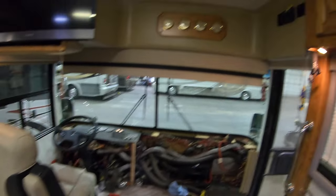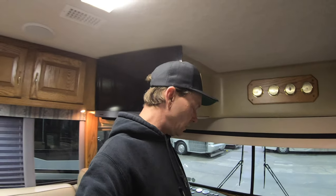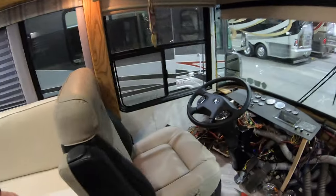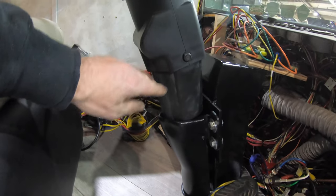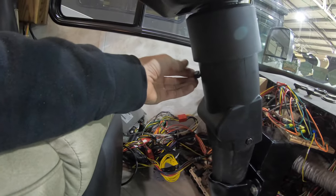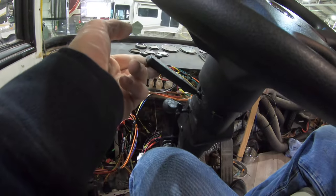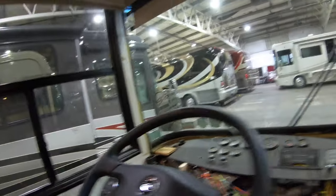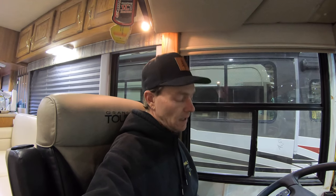One of the next things is to get the overhead out of here, but I really just want to get back out RVing — I've got a race this weekend. The smart wheel is in. I've got the steering shaft cover secured, the clock spring is in, hazards are working, and the turn signals are working. Another nice part of this column upgrade is that I've now got the high beam switch right here at the end of the stalk — no more hunting for that pedal on the floor like I was driving an old 70s Chevy pickup.